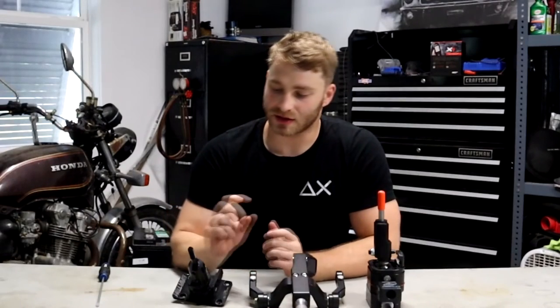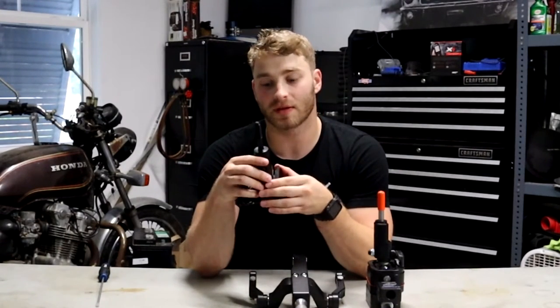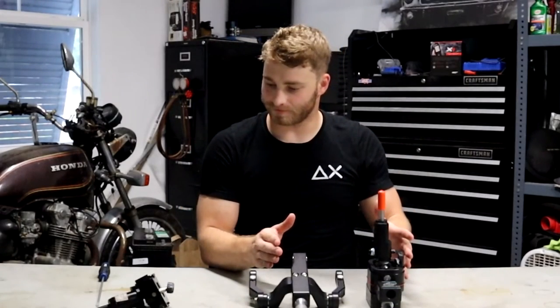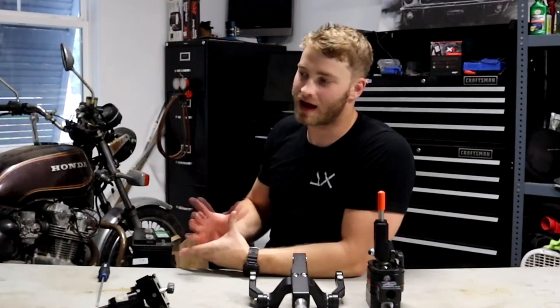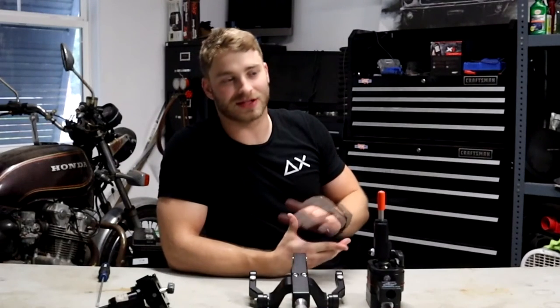I feel both of them are great. The only reason we upgraded to the MGW is because we upgraded our transmissions to the Caliber Stage 2 and Stage 3 transmissions, and we had some issues with compatibility with our Barton. Caliber says that this issue is pretty common for them and that they just don't recommend Barton. If you're looking to get an upgraded transmission, you might want to go ahead and not waste the money on Barton and get the MGW instead. It's compatible with a stock transmission as well. If you don't care about getting an upgraded transmission, the Barton's going to do you just fine — Barton has never done me any wrong until we put those transmissions in.